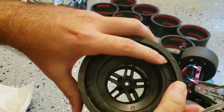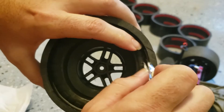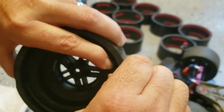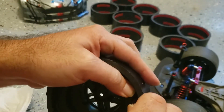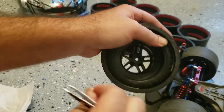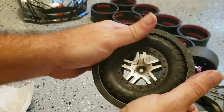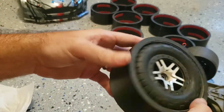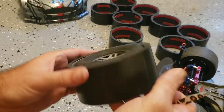Pull them out all the way around, all three of them — you can see how easy it is. I tried this without the tape and the rings, when you're drifting in a corner and you hit something like a lump, they'll actually pop off the tires. And I tried just doing one side of the tire and after you start hitting a bunch of stuff it gives you a wonky, wobbly rim. So this is the best way to do it after two years of making and using these on my own car.